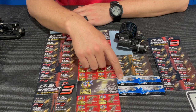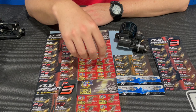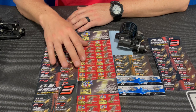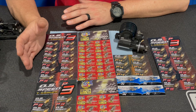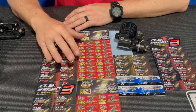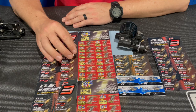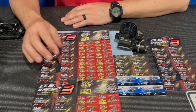There are also a bunch of plugs out there — Protec has their own P3 and P4, and they also have a T3 and T4. Pretty much any plugs branded P3 or P4, whether it's Protec or Ninja, are still OS glow plugs. If it's a T4 or T3, that's usually a different manufacturer. If you use those and have good luck, that's totally fine. For me, my experience is with OS plugs. When I ran Novarossi, I always ran Novarossi plugs — I felt like they were designed for those engines. With OS engines, I use OS plugs because that's what they're designed and developed for.